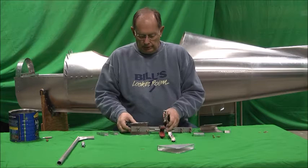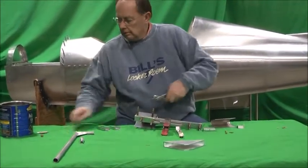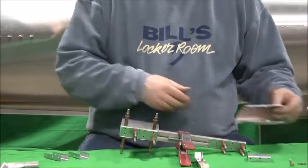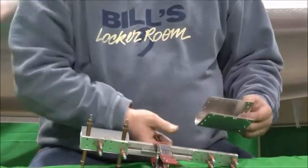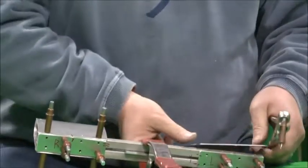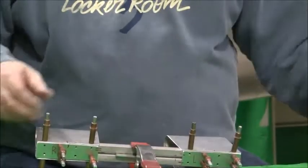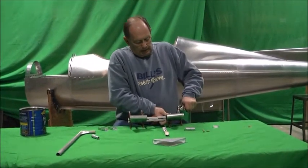It's a home-built, so you can certainly feel free to make adjustments or tweaks that fit your feet a little better or for your comfort. This one pedal has a 3/16th hole through the top — that's actually for the rudder drive. We'll cover later how that drives off the left side of the rudder bar only. As you know by now, the H5 is all controlled with push-pull tubes. There are no cables. Maury was a real fanatic about keeping things simple and positive controls. We don't have any pulleys or cable stretching or tensioning problems to worry about — everything's just directly connected.